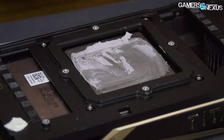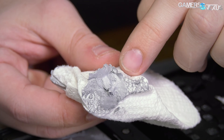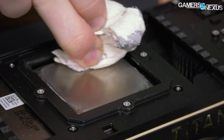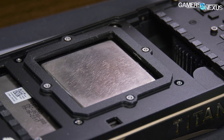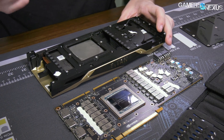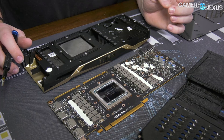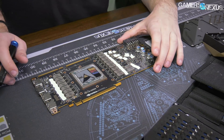There's our GPU all shiny. This is about a truckload of thermal paste — you could do multiple i9 CPUs with this. Again, it's not a bad thing, it's a lot of surface area to cover, but it's just kind of amusing. With CPUs there's kind of a limit on the IHS as to how much compound you can put before you're actually making performance worse. With GPUs that's not really the case — it's just exposed, there's no IHS to worry about. If there's excess it'll come out the side, so it's okay.